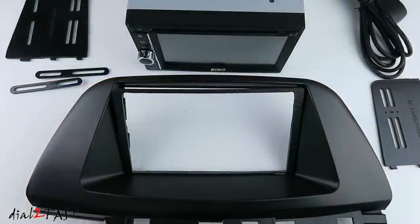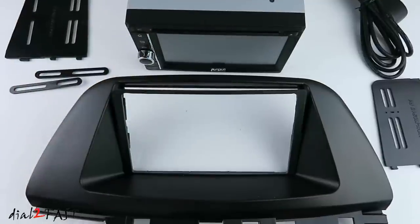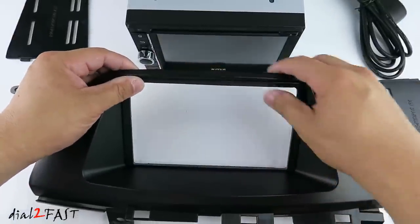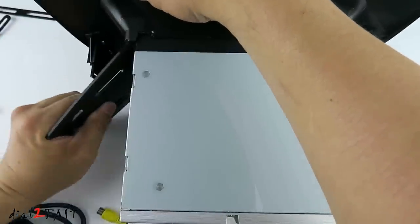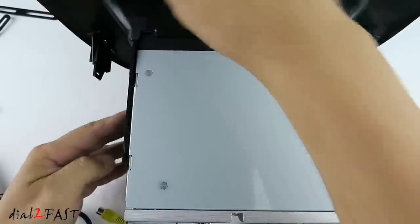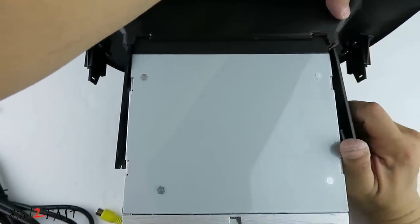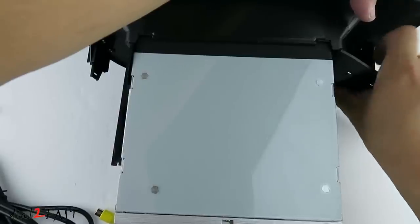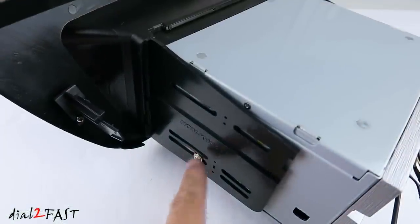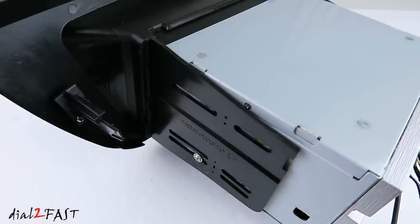Here's the installation kit for the Honda Odyssey. I had to file down the top edge and side of the bezel to make it fit this aftermarket radio — typically you do have to modify the opening dimension. This trim goes in, then the bezel fits directly onto the stereo, and then you install the side bracket. The last time I installed an Android 6.0 double-din stereo I used a kit from Scosche, which is a lot better. This one is made by X Scorpion and has a lot more pieces. Install a screw on both sides to secure the unit onto the front bezel — the screw that came with the unit isn't long enough, so provide your own, but make sure it's not too long because there are circuit boards inside.